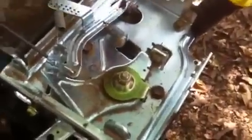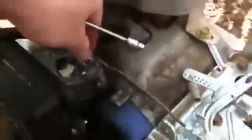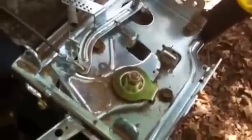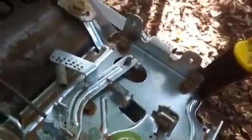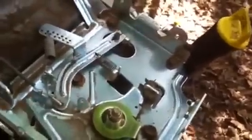All you do is loosen this up. Tighten this nut up — got it fully opened. Turn the shaft until it stops. I'm going counterclockwise and it's stopping. You don't have to force it or anything, just turn it until it stops — counterclockwise — and then tighten this nut up real good and tight, because you don't want it to move. If you don't have this good and tight, it's going to go out of adjustment again. It doesn't take much — it can be a hair and it can go out of adjustment.